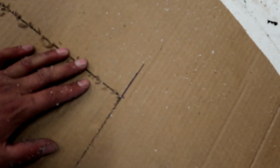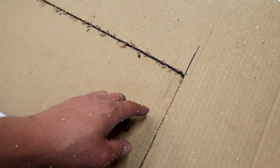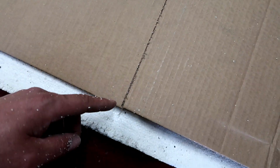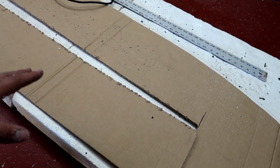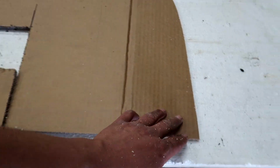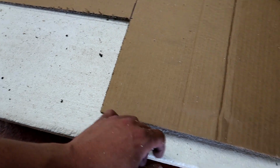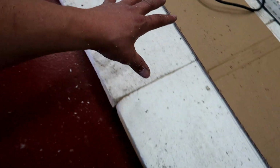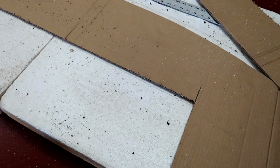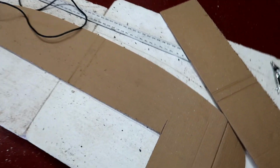So I got it taped up there and I made an impression, which you can barely see, it's right here. I measured back, just a little bit past there, which was 8 inches. First thing that I did is I measured the traction bar and it is exactly 3 feet wide. So I marked 3 feet inside of our splitter here, right in the center. I forget what the measurement is, but the distance from here to here is exactly the same on both sides. So I basically centered 3 feet inside of here and then measured back 8 inches, drew a straight line across, and that's our section we got cut out. And I'm gonna go ahead and test fit it one more time. I might end up having to cut it up a little bit further. I don't know, we'll see.